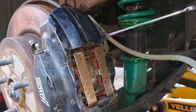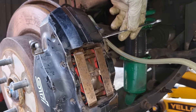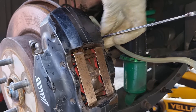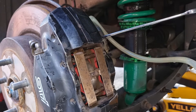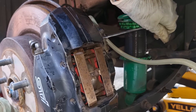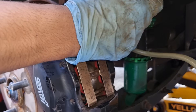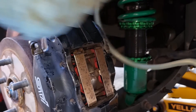Pump, then hold. You just want to do this procedure until you see new fluid or until all the air comes out — whichever applies, because if you've changed your master cylinder you definitely want to run this procedure. It's very important. Keep repeating: pump, then hold.